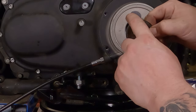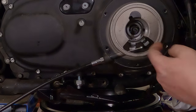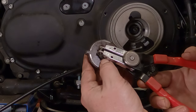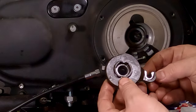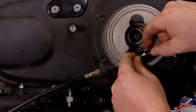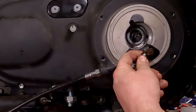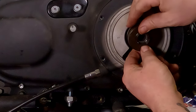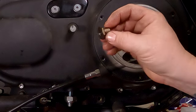If you're wondering which way it goes in: this little pin — the boss goes 180 degrees from this piece down here. Remember it slides in this notch and then this cable hooks into that little piece right there, which goes into here. Next we'll reinstall the snap ring now that we've inspected it — make sure it's down in the groove. Take your clutch cable, hook it back onto there — you'll see it kind of pops in, pulls forward, locks itself in place. Take this, start almost all the way down, spin it all the way up to 12 o'clock and it should slide right back on in there.